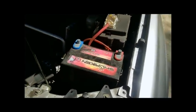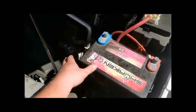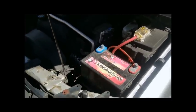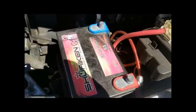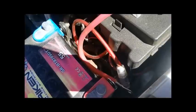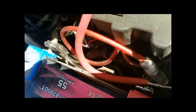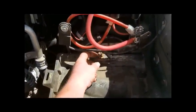The first procedure is to remove the battery just to clear up some space. We're going to have to remove the alternator, but it's not that big of a project. In removing the battery, your stock terminals are probably 8mm. This particular battery has a stereo so one side is a little bit larger, but it's already loosened up. Once you get your terminals all disconnected, there is a 13mm hold-down bolt you've got to get out — here's another shot of that 13mm that holds your battery down.